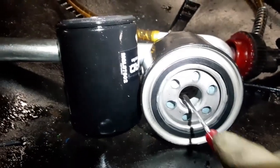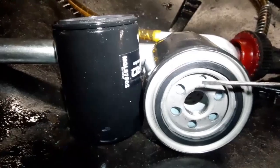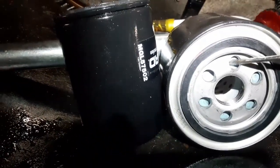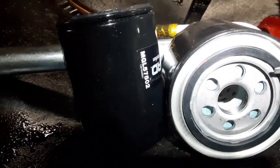What that does is when you're pressurizing it, the oil is backfilled into the oil filter and it hits this and stops it, so it never makes its way down into the oil pump. So when I was doing this the first time, I realized there was a problem because I wasn't getting any oil pressure when I was cranking it over, but I'd primed it.